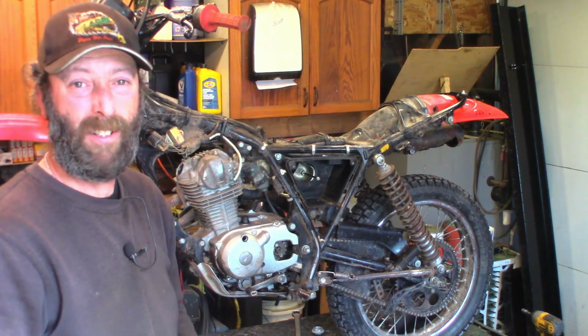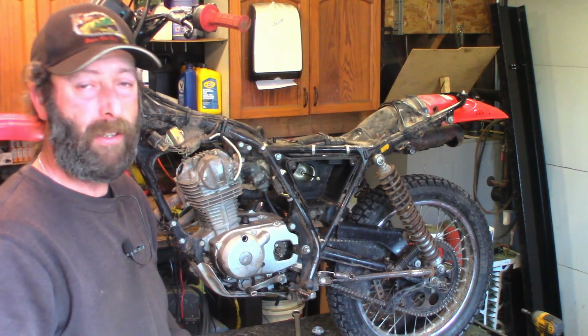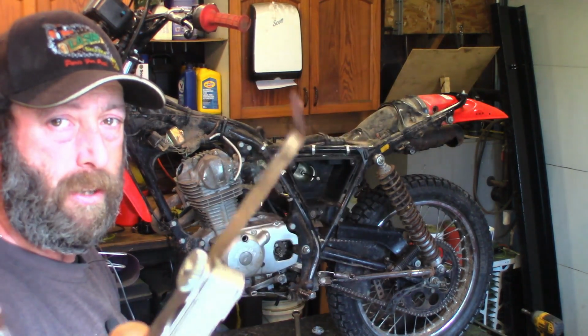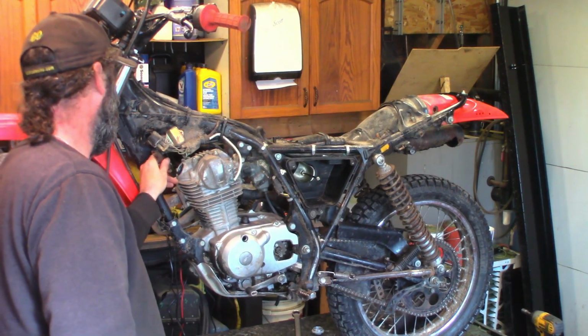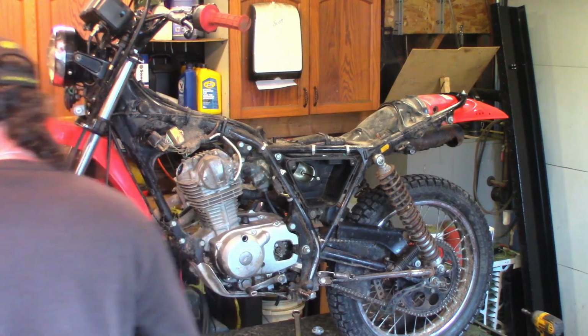I read it before, it's actually 0.05 millimeters or whatever, but it's 2 thou on intake and exhaust on this engine. And I've got my fancy, previously enjoyed feeler blade that I bent to get in the last one I did. So let's slide it in that exhaust one. And you can probably park a bus in there. So we're gonna need to adjust that.